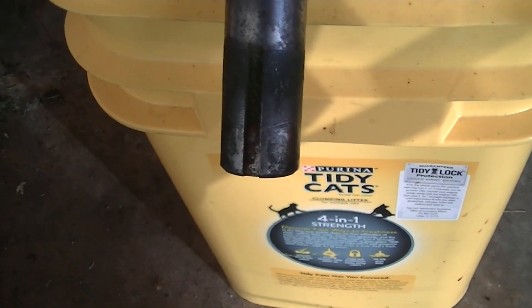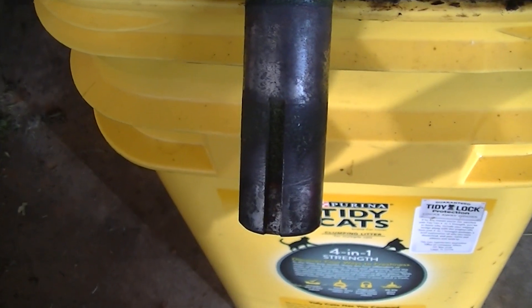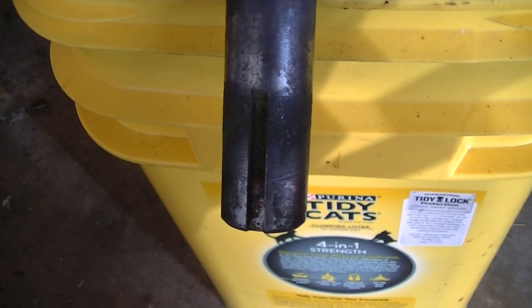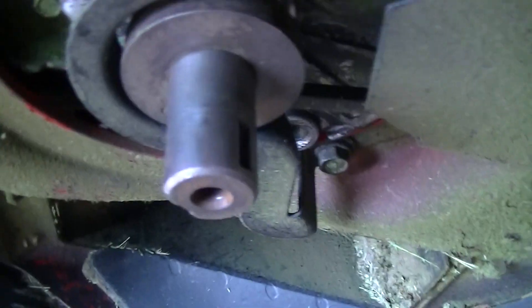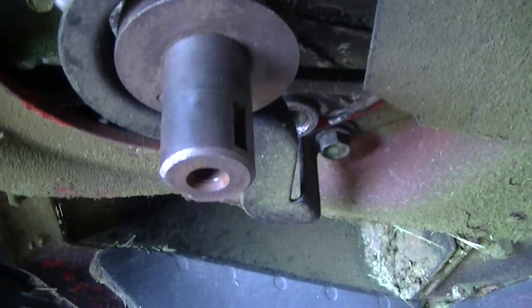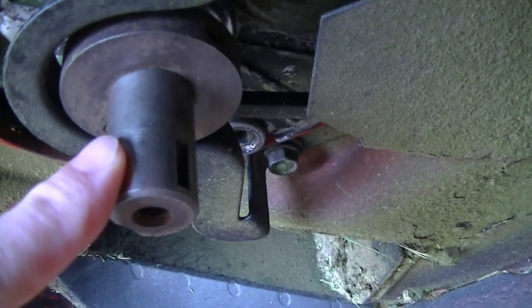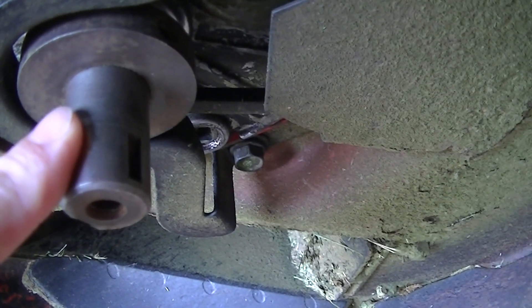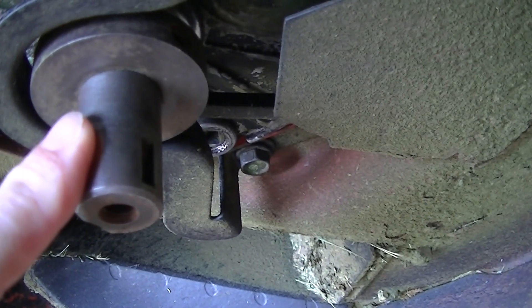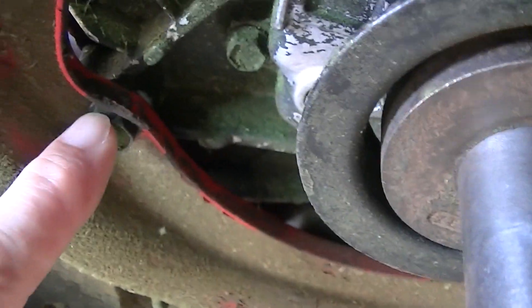So, what I ended up doing was something a little different. Let's move over to the mower that now has the engine swapped onto it. Here we have the donor overhead valve mower engine installed. The shaft diameter is the same — I believe it's 25 millimeters — the same as the old engine, the Briggs Quantum. You can see the bolts here where the motor mounts on.